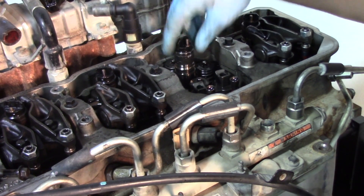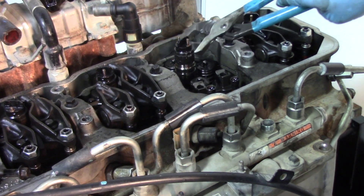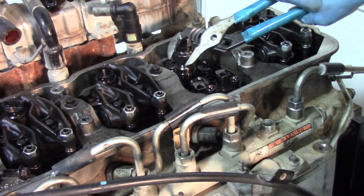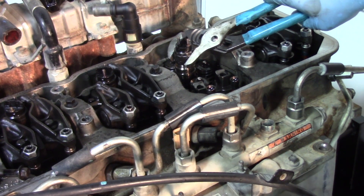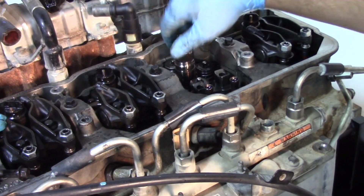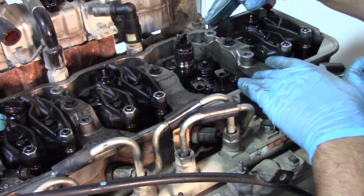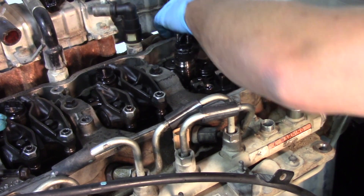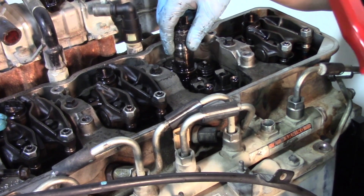Because these have been in so long and are tightly compressed, you want to get the injector moving freely. I found it's easiest to grab a pair of channel locks and gently guide it back and forth until you get some movement. Be careful — this is a vital core, meaning when you purchase your injector there's a core charge and you'll be returning that core, so go easy on it. Once it's moving freely, I just took a small pry bar — nothing that would cause damage to the cylinder head or injector — went in from the back side where there's a lip, and gave it a light tap. It didn't take much at all once it was spinning freely from using the channel locks.